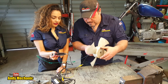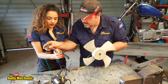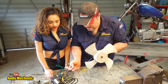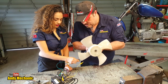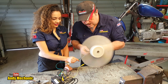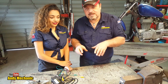That one seems to be okay. Let's see if that fan will start up. We can unhook it off the test light and put it straight on the battery — there, look. Connect that to the blue wire and the fan should fire up. Oh, there we go — that's a nice breeze! So that one's pretty good, it's passed the test. We can turn it off now before I lose any fingers. So that's motor one done. We'll rig up the camera for a close-up and test the second fan.